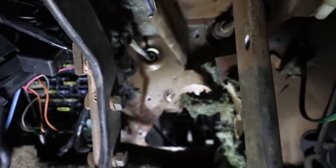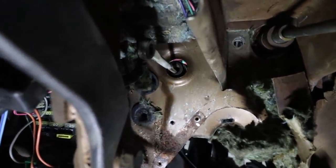All right. You can see the master cylinder up there has nothing to connect to. But I marked the pedal. Oh, my light is bad. Let's try this. So I marked my pedal up here. So I've got to make a tab off of there, but I'm not going to go very far. What I'll do is I'll extend the rod to it. It has a throw to it, but I don't think it's going to exceed the slave. I keep saying slave, the master.